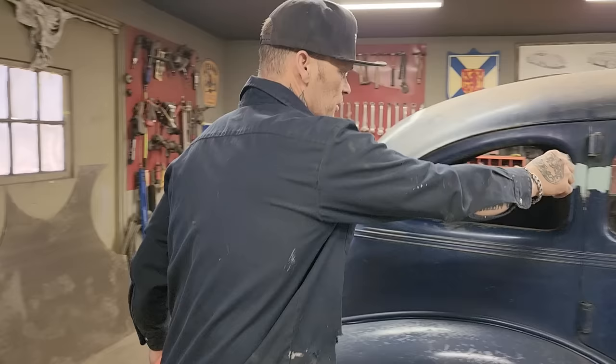I think them front wheels deserve to be covered up, and the reason being is I spent time cleaning them. On them front wheels, they're just like the back wheels. They're gummed up quite heavy. The spray 9 took a lot of the dirt off, but in order for me to get them looking nice, I used a wire brush. So I sprayed spray 9 and a wire brush, and I just wire brushed them all the way around. Did not hurt the wheel whatsoever, but it cleaned the white wall. Now that's what it did, it cleaned the white wall.